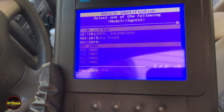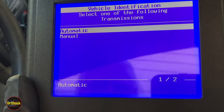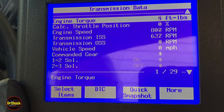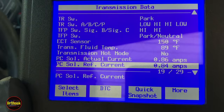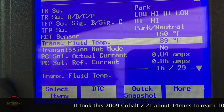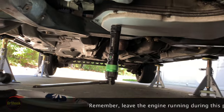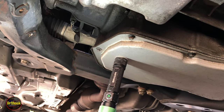Let's go into our Tech 2 scan tool and build this particular vehicle — going to powertrain, this is an L4 engine, automatic, then transmission data to see what our fluid temperature is. You don't have to have this particular scan tool, but you're going to need something that can read the PID for this value. We're sitting at 89 degrees, so we're going to wait for this to heat up to 104 degrees and then we'll start the check procedure. Once you're at the right temperature, come under here, remove the plug, set something down to catch any drippings, take the plug out, then go up on top and add until it starts drizzling.